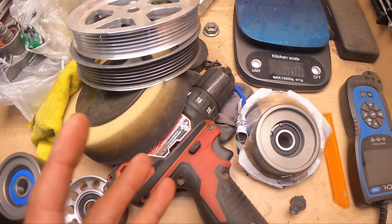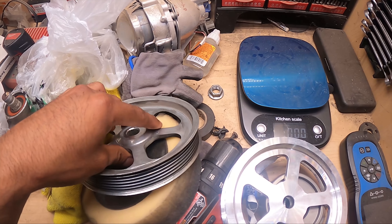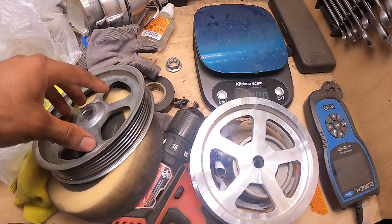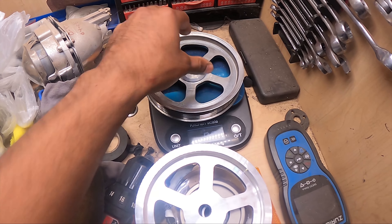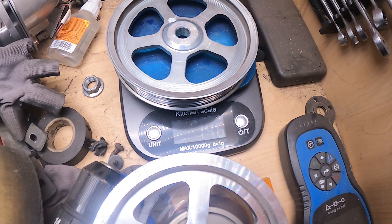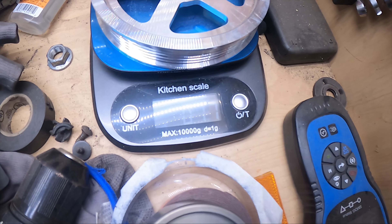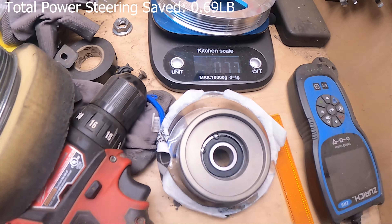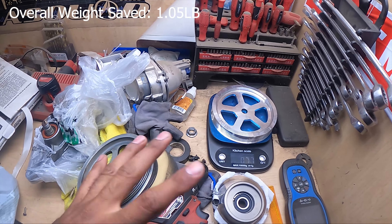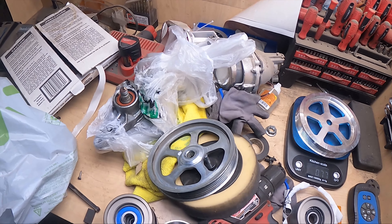Alright, this is very cool little things to know. And then in the Gerze kit it also comes with a lightweight power steering pulley — Gerze is the only one so far that I know makes it. So these are the only two comparisons we're going to have. The stock power steering pulley is 1.46 pounds, and shockingly the lightweight Gerze one is about half the size at 0.77. Pretty good weight savings — I'll add the total weight saved. We're going to go ahead and start rebuilding the power steering because I got rid of the other one, and put all this back onto the engine.